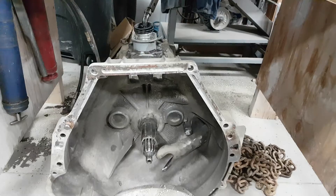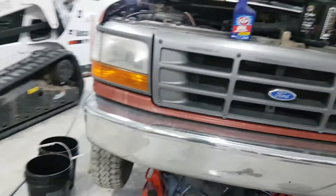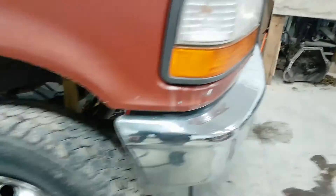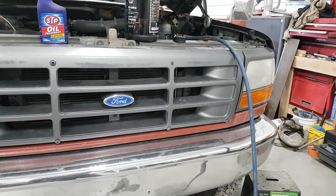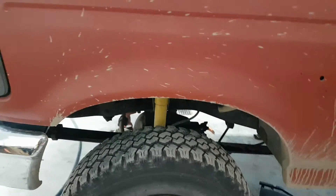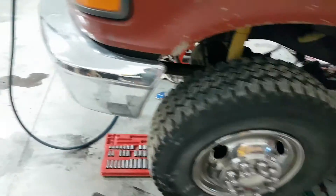The only other thing I wanted to mention: your frame bolts — try to put anti-seize on anything you can. I didn't use much thread locker, but you might want to throw tiny little dabs on your bell housing bolts, because there was one loose when I got into this truck. Just a tiny little bit — and don't torque the living daylights out of it either. That's all I wanted to mention.